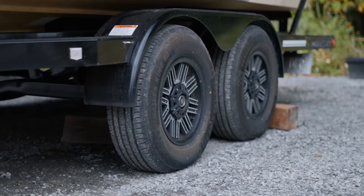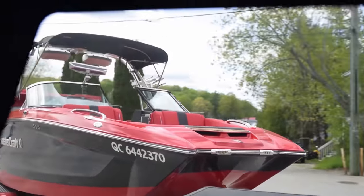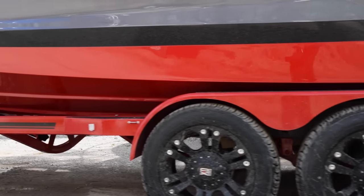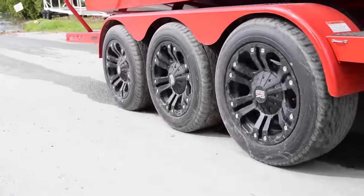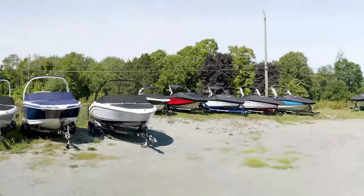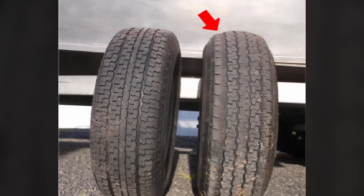You're gonna wanna inspect the tires. After every single trip to the ramp and back or to your cottage and back, make sure there's no visible damage from punctures or hitting curbs, no slices, and make sure the tread has lots of wear left. Trailer tires from trailer manufacturers often aren't the highest quality — that's one way they keep the price down — so they really don't last that long. Trailer tires sit out in the sun all season long with weight on them and get weather beaten. We pay really close attention to the boat, but not so much to the tires.